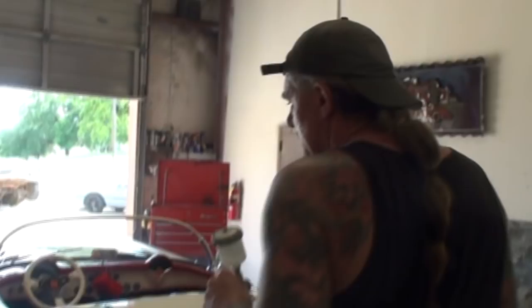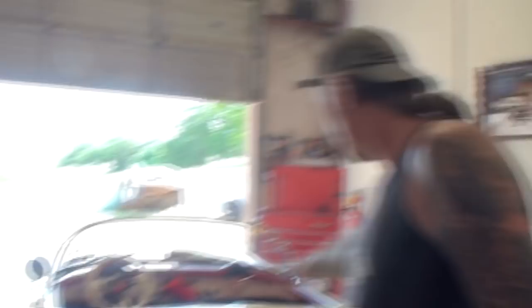The HVLP mini Sata 2-ounce cup sprayer - usually the brush-touch-up action works, but for some odd reason brushing this paint on doesn't match. So we've gone to the extreme, and I'm going to tell everybody out there: if you don't know what you're doing and you've never done this before, give it to a professional. Because I'm going to tell you right now, you can mess your car up. Look at this quarter panel - there's no cutoff points anywhere. If I mess this car up, I'm going to have to paint the whole back end of the car for this one little rock chip.